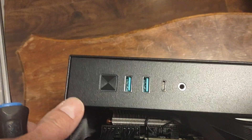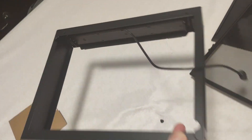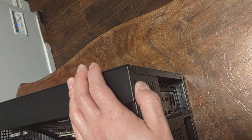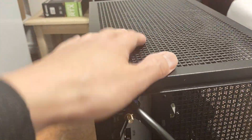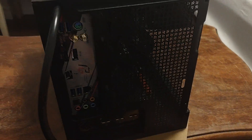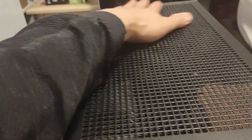One caution: there's just one screw here and one screw here — leave those because the four bottom screws overlap this area. Don't screw those in; you'll figure it out when you can't close the case. Also, when putting the rear panel back on, make sure you route your power supply cable through the bottom first — otherwise you'll have to take everything apart again.